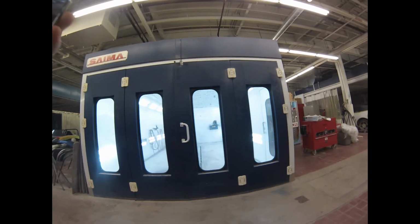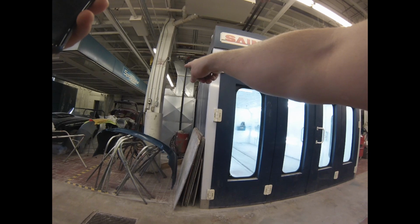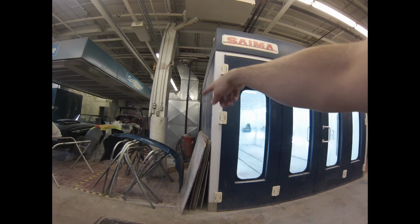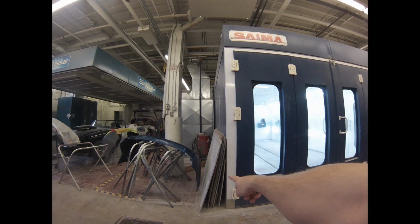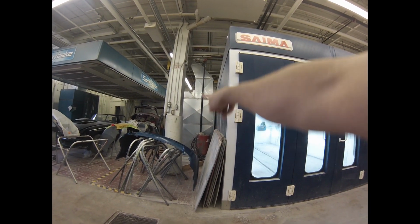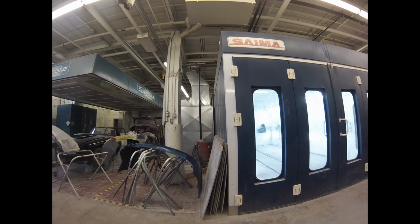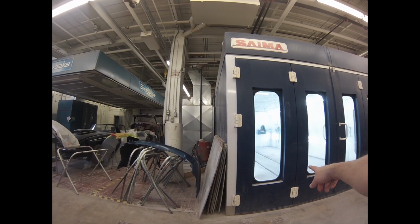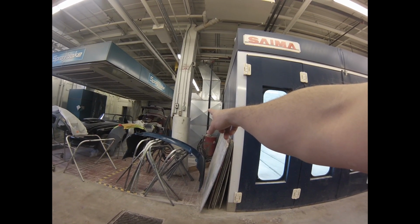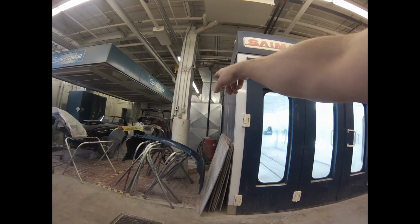And the air that's being sucked out is actually over on this side, which is the exhaust stack, right? So over here you can see another duct going through the ceiling of the school. This is where it exhausts outside. It goes into the floor, goes through a tunnel underneath in the ground, and then it goes up into here, into some filters, then into a fan, and then up into the atmosphere, and all the fumes go bye-bye, right? So there's two exhaust filters, one in the floor of the booth that we're going to check out later, one inside here, primary and secondary exhaust filters to make sure nothing gets caught up in the stack, nothing gets caught in the fan down there.